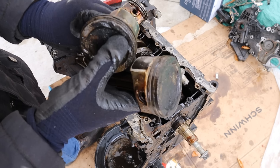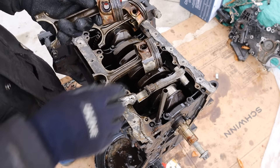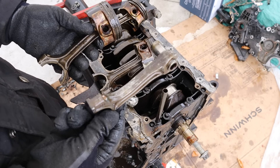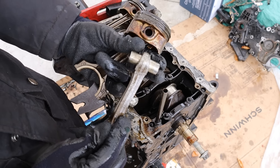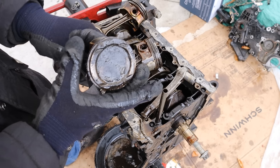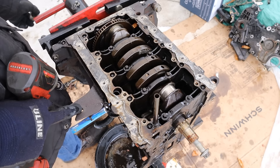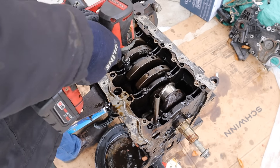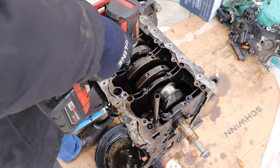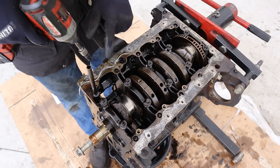You can see most of the stuff is full of that mud, which is the oil and coolant mixing together. The connecting rods — they feel like they've actually got quite a bit of weight to them, which is probably why this one didn't obliterate itself. Wrist pins are also known to be very strong compared to the rest of the engine. Now this is only a 1.4 liter engine, that's why the piston tops themselves are actually pretty small — they look kind of cute. GM is using some really tiny fasteners for the main caps and the connecting rods — these are once again an E10, like equivalent to an 8mm bolt. Also securing the upper oil pan to the block are these little E8 bolts.